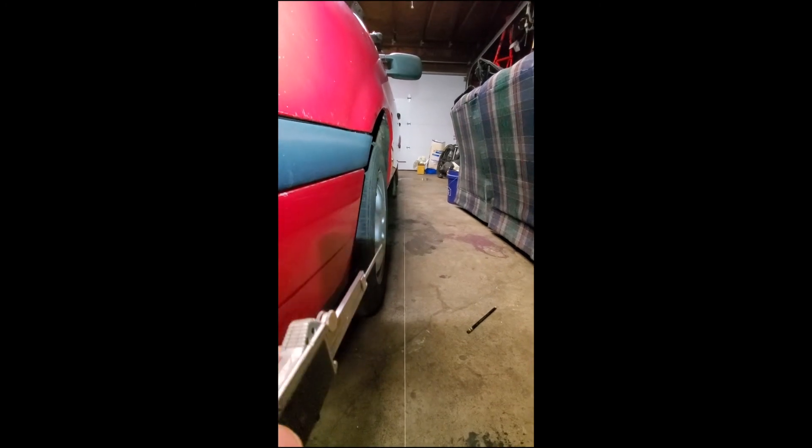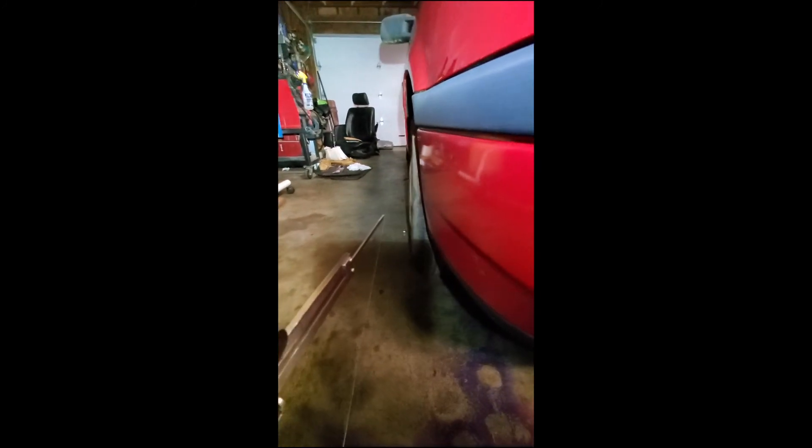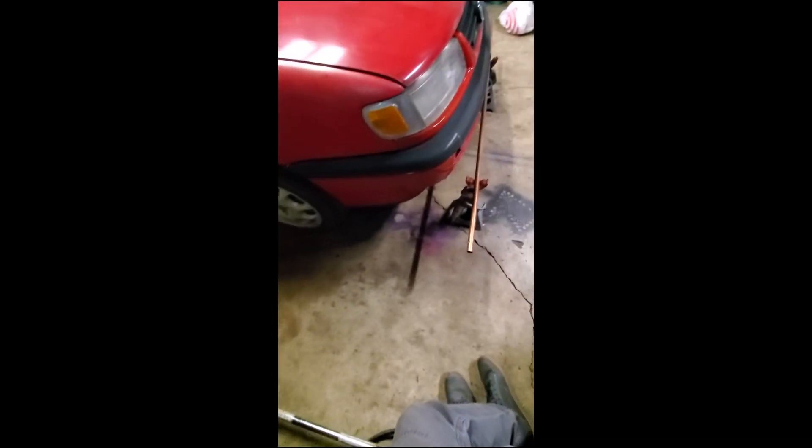Let's talk a little bit about camber. I don't use tools to set camber — I just do it by eye. It's a Volkswagen, so I just sit down here, eyeball it — see it's cambered in just a hair. Pop off to the other side, look at it — she's cambered in just a tiny little bit. That's good enough. It doesn't have to be super precise with camber; that's not going to mess with your steering unless you're into tracking or doing race car stuff. You can do all of this with found objects and just a digital caliper.